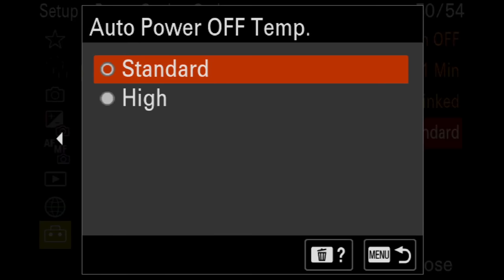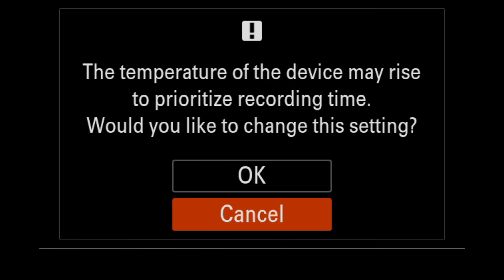I was concerned about overheating since there's no active cooling. Recording at room temperature with the heat threshold set to high, I was able to record for 46 minutes in 4K 24p — not great, pretty average for this class of camera. Switching to 4K 60p in the same situation, I was able to record 26 minutes before the camera shut down. So if you're planning long-form recording at 60fps, you will run into overheating issues. For webcam use, I was recording at 1080p output and with the overheat threshold at standard, it conked out after only 25 minutes.